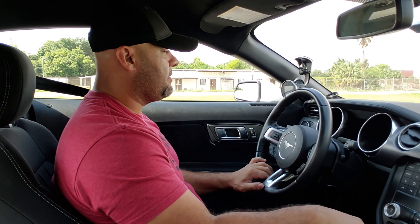Looking at this data log, I'd tell the customer: 'The thing is legit, go enjoy it.' At 7,100 RPM, timing is at almost 18 degrees, load is very tame at only 1.3 — meaning this car is maybe making nine pounds of boost. It's a 3.6 pulley, so it's quoted for 10 pounds, but at 7,500 RPM it might generate 1.3 load. This feels really good. Fueling is beautiful, the limiter is set at 7,750 — I'm happy.